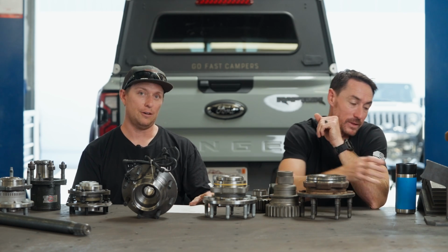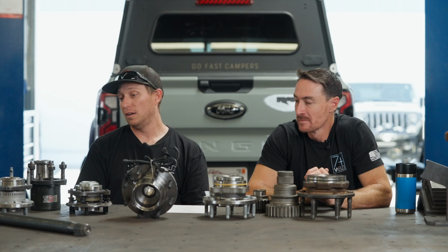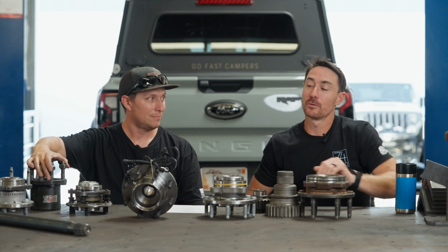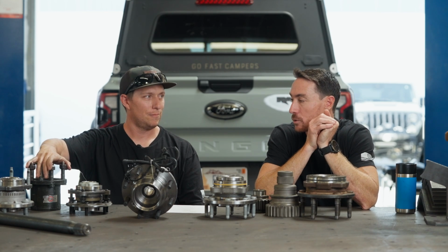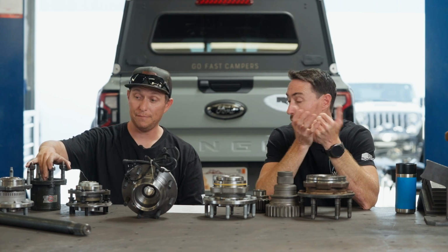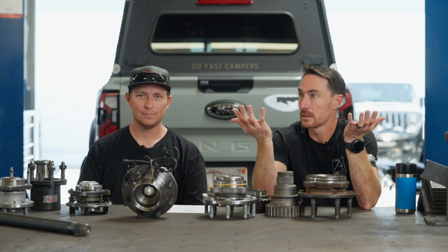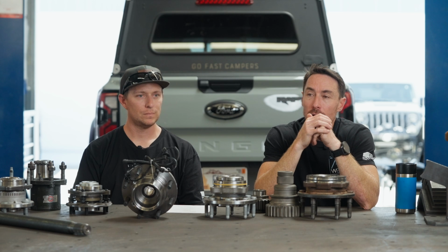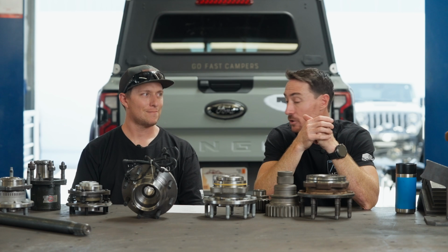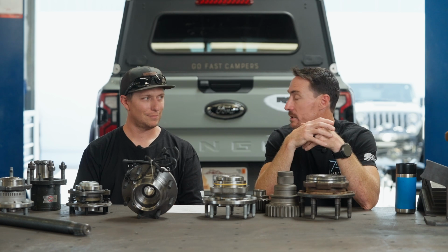So that's what's out there as far as if you buy an OE vehicle. If it's a heavy duty vehicle, you're going to have full float stuff. If it's light duty, you're going to have semi float, well, some combination. They're starting to move certain heavy duty applications to unit bearings now, on the rear. You've seen them in the front end of vehicles for 20 years at least. On the rear of a Chevy 2500, you have a monster unit bearing, a cup and unit bearing design now.